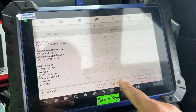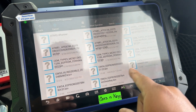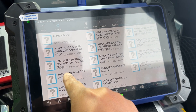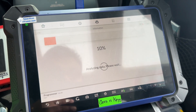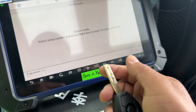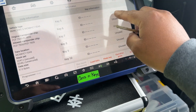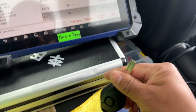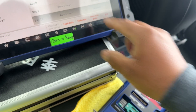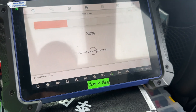Let's go to Load Data. I'm going to go to BMW — right here, BMW Z4. I've already cut the key and tested it — it works. Everything is set. I'm going to select the transponder, place the key right there, and make a key.